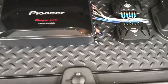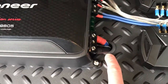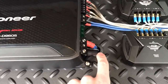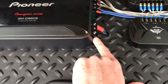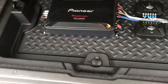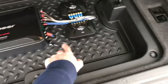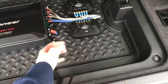The problem I ran into was the ground wire, since the layout of this amp puts the ground and power wire right here. I used another three-quarter inch grommet, drilled out one of these ribs, and that allowed me to run the power and ground wire. If I were to do this again, I would probably reposition some things so I could put this grommet further out, because since these wires were so thick it made it hard to bend them up and into the inputs. The ground wire and power wire run through about two ribs and then around underneath over here to a ground inside there — I would suggest running the ground a shorter distance, and we almost ran out of distance on the ground wire.